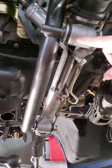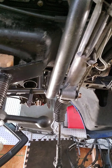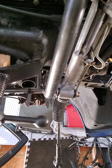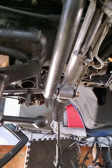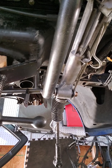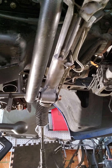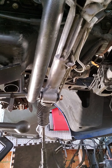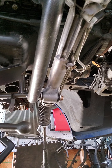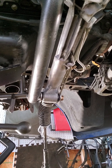One other thing — whenever you're putting on bushings, I have a big jar of the Energy Suspension grease, the lubricant that you use for pretty much everything you put on of theirs. And J&M suspension — my lower control arms and uppers used the exact same stuff, Energy Suspension tacky grease. I put the same on there, pushed it in, made everything work, bolted it down. I'm a huge proponent of using stuff like that because a lot of times people put in high-performance parts and they don't do the simple things, like making sure you grease everything or have some sort of recommended lube on it.